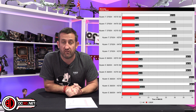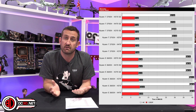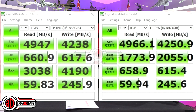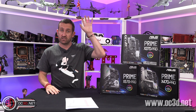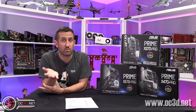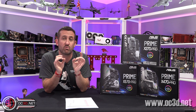When you look at hard drive performance, surprisingly we did get PCIe 4 speeds with our Gigabyte drive running at 4900/4200 megabytes per second, and we did get those numbers with X370 as well. With X370 and PCIe 4 drives, I do need to stress it's going to depend where the M.2 is connected to. Because some of the M.2s — if you've got multiple M.2s on the board — then one of them was probably going to be wired into the chipset itself rather than direct to the CPU. You need to have the M.2 direct into the CPU because it's the CPU that has the PCIe 4 capabilities. There are a few minor boards out there that just won't work with PCIe 4 at all.